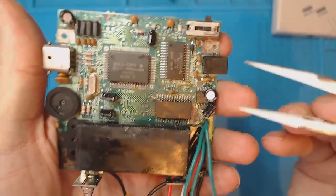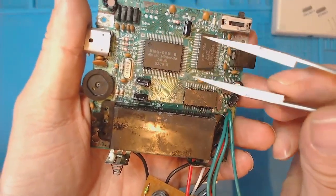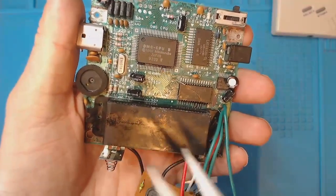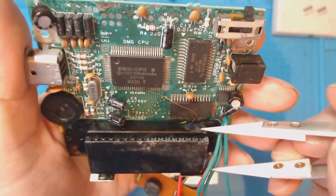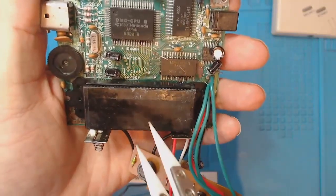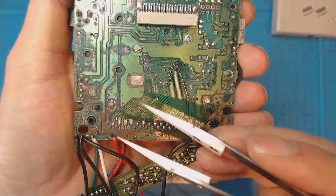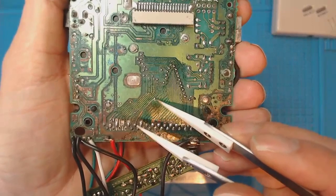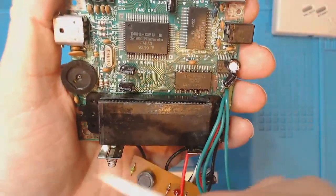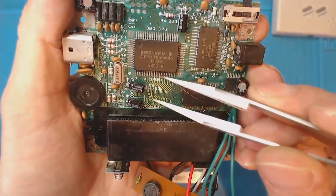So my initial attempt at fixing this: I put some jumper wires from the bottom pins on the RAM up to the CPU pins just here. I've removed the card slot and soldered tiny jumper wires down there. Unfortunately this pin was soldered onto a wire underneath the card slot, and when I put the card slot back on and soldered another trace to the wire on the other side of the board, the original one I'd soldered underneath must have popped off because I lost continuity for it. I had to put a new jumper wire directly from this pin to this pin to get it working.